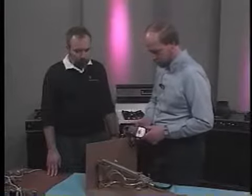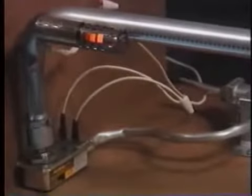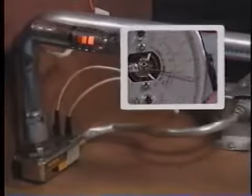Okay, I see the glow bar is starting to glow. It's going to glow, and the meters. After a while, I believe a tech will develop a knack for looking at the glow bar and the color of the glow and determining by the color that it's just not pulling the right current. Because we noticed a while ago it got up to a white hot. It's right around a little less than 2 amps.